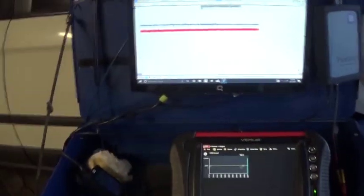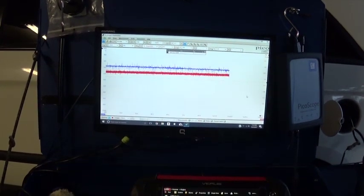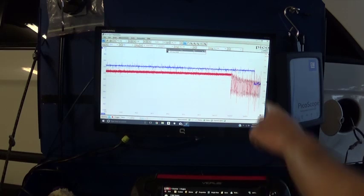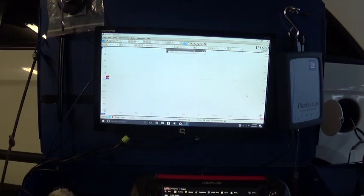So I'm gonna pump the vacuum again just to see if my purge solenoid is messed up. So I'm gonna do this again. Okay, my switch is closed. I don't like that. I'm not sure. But we can see we are still losing vacuum pretty fast. Yeah, the switch is going to open pretty soon actually. So the next step we'll have to get the smoke machine and see if we can find a leak.